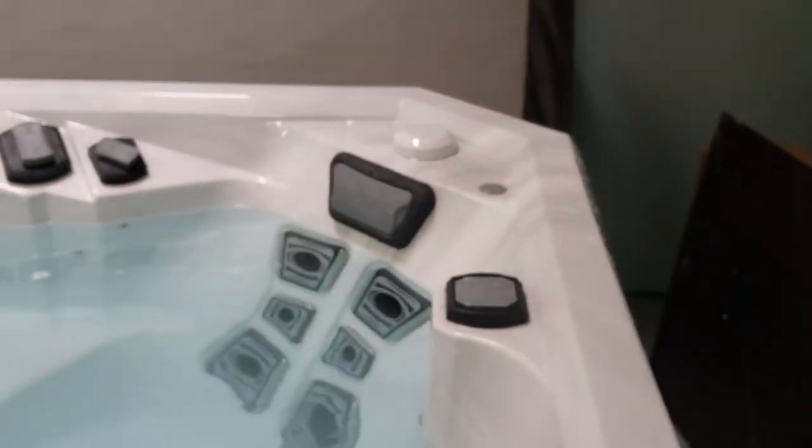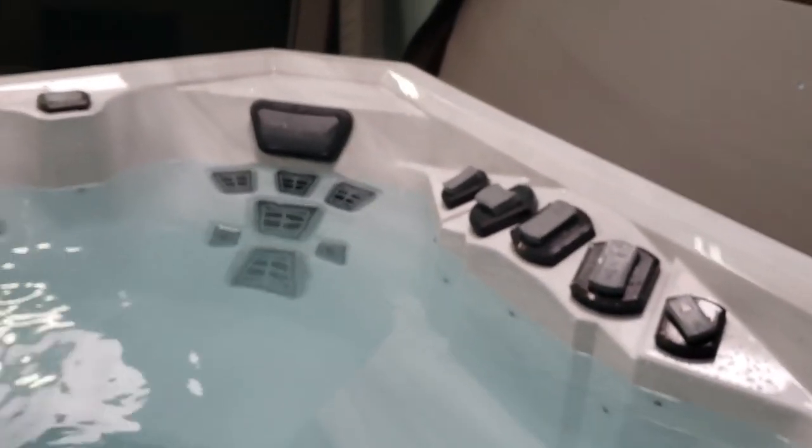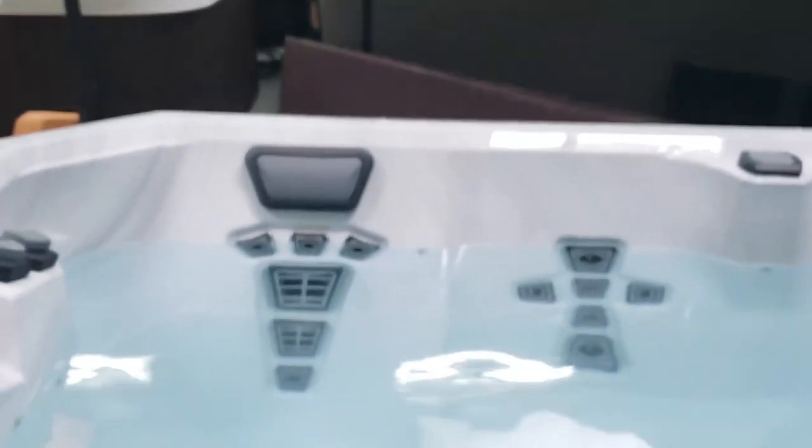Although it's kind of cool that it makes micro bubbles, it just makes your water look cloudy. Dubious at best — I'd love to see some studies. If you've got some studies, send them to me. I love innovation — you come up with something innovative, I'm all over it, especially if it's good tech. But this is not innovation, this is BS marketing. They made everything different shapes and called everything different names. Diverter valves aren't called diverter valves anymore, they're called some fancy stupid name. The air injectors aren't called air injectors. All these jets with different faces on them — none of them made any difference. When I got in the tub it felt just like a regular tub. All the extra diverter valves did nothing but make it confusing and add more parts to fail.